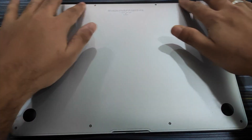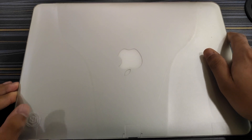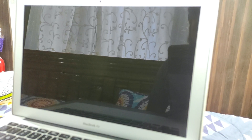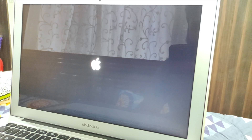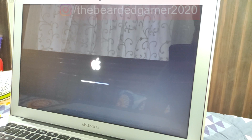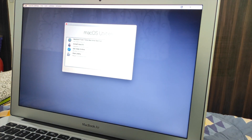The physical installation is done. Now you'll need a bootable USB stick with macOS Catalina — or whichever version you were using — pre-installed on it. I've linked the process for creating one in the description. Start up the system and immediately hold the Option key, then click the arrow below it. The system will go into recovery, giving you access to Disk Utility. We are now booted into macOS Recovery — click on Disk Utility and click Continue.